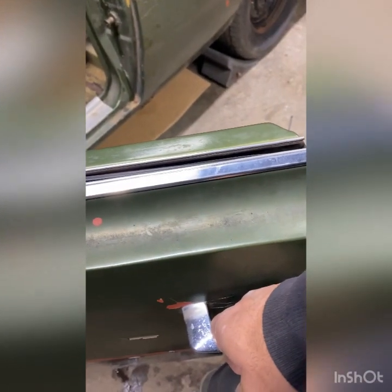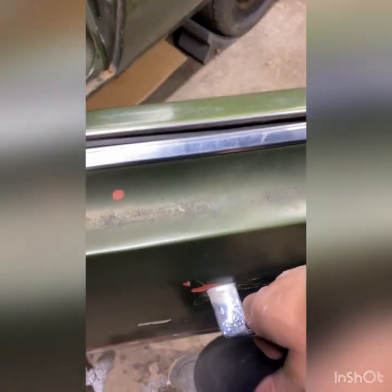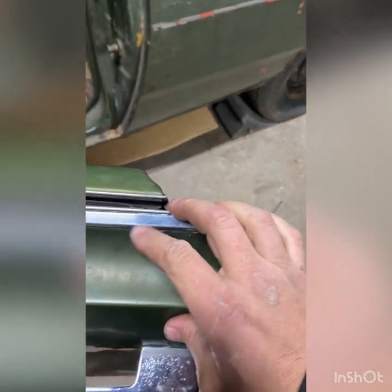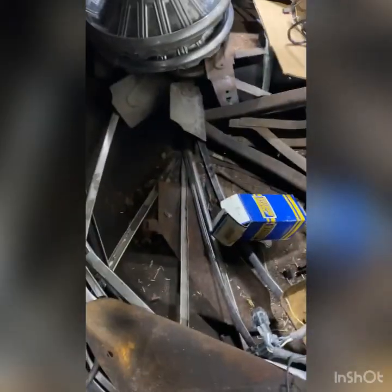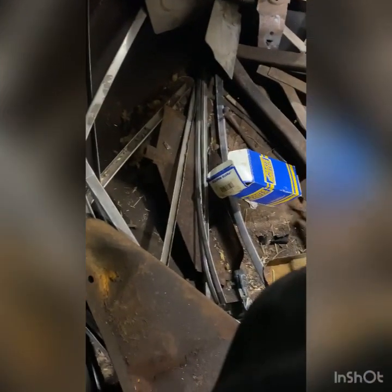The reason that striker is ripped out is because the lower door hinge is bad — the door moves up and down. Like normal Mopar A-body, the striker rips out. The front valance we're going to have to straighten out — we might find a new one. Yeah, but he's got the bottom part of the seat out, took steel wool to the bumper right there, actually cleaned up pretty good. Hit another part there — looks pretty good too. There's the header panel. The trunk — I'm not sure what kind of shape it's in, but this car's got the original quarters on it still.